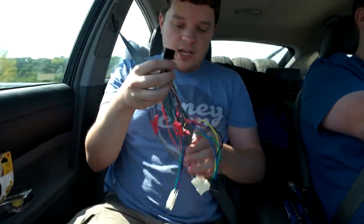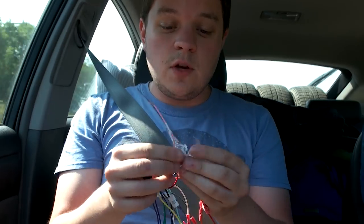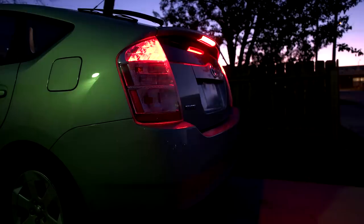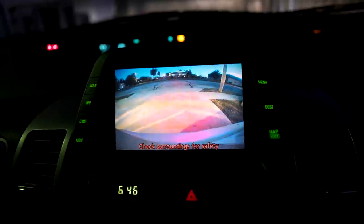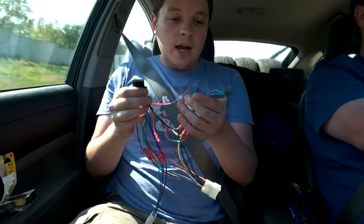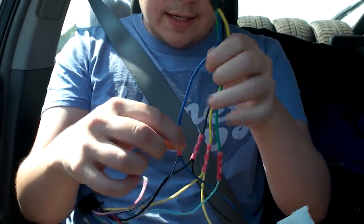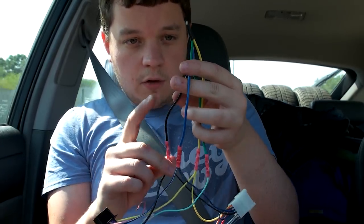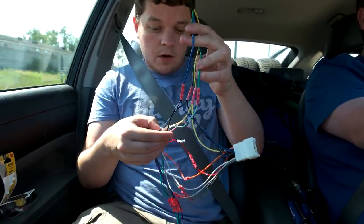I just finished here. The only two wires I have left are a pink one, which doesn't match anything so I'll just leave it, and a purple one marked as reverse input — you can hook that up to the positive end of a rear tail light to activate a rear camera, but the Prius already has a rear camera on the main screen. There's also the parking brake bypass, which you only need for Pioneer head units if you want to play movies while driving. I connected the blue to those two wires, the ground wire to the other ground wires, and the green one to the green, also marked as parking brake.